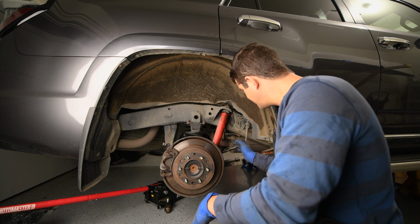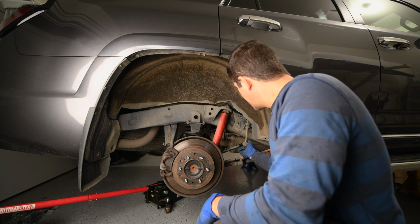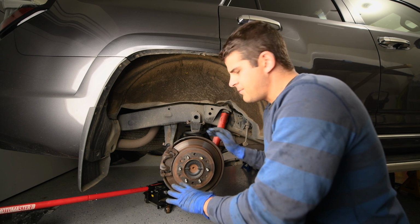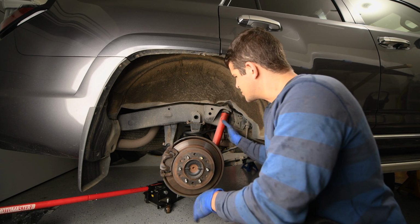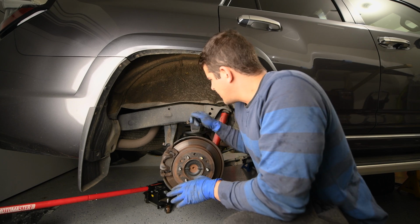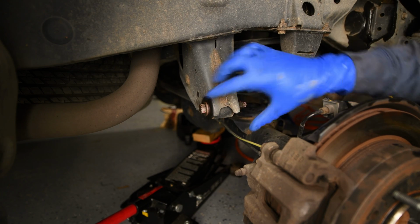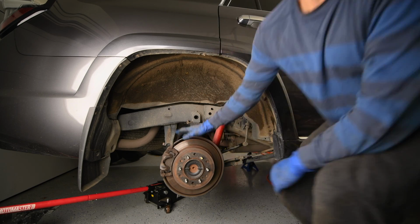And then you have to remove the bolt that's going up to the sway bar end link here. I think that you can put an Allen key on the back there, and it's a 17 mil to undo that. Make sure you have a lift under your rear axle. As soon as you undo your shock, it's going to drop down. So I've got that under there. In order for your axle to drop down far enough to get the new springs in, you may need to undo your track bar, which is right over here, and those are 19 mils. So anyways, let's get into it.